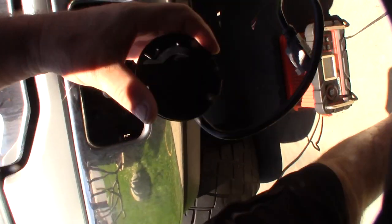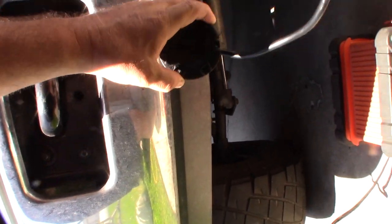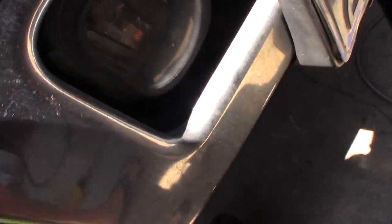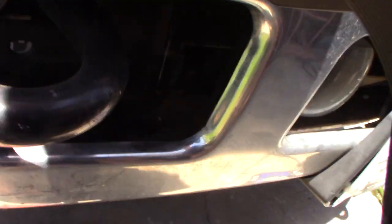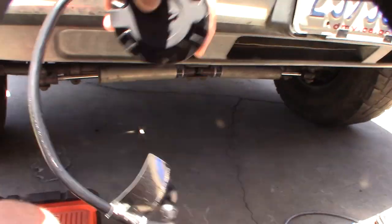I'm going to drill a hole through the bumper - I'm thinking through the metal here rather than the plastic, because sometimes I've actually forgotten to take the float charger off and ripped cords out. And when I'm done with this truck, if I ever sell it, I can hook it up to the block heater cord - there it is right there - so it could double as a block heater outlet in the future.